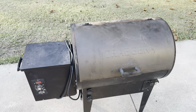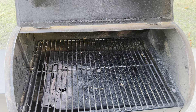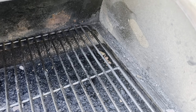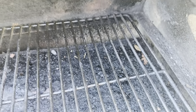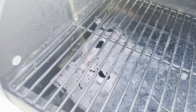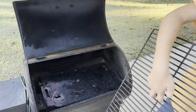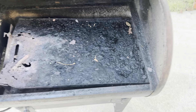As we're opening this up, 100% of the time these grills are going to look like this. Your average person does not take the time to clean the pellet grills out like they should. You can see the build up from all the different cooking and smoking — that's really what causes the fire. The tray's worn out, the grease is built up, and all this build up as you're cooking causes fires over time as the grease drips down onto the fire source and starts a fire, overheating it and getting it hot like the outside of this one.